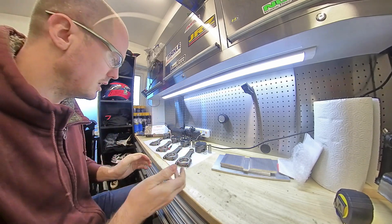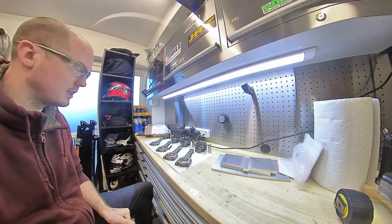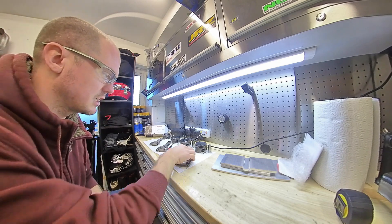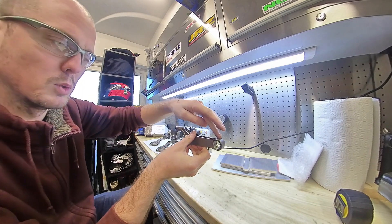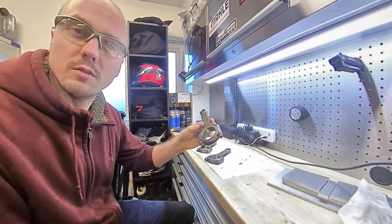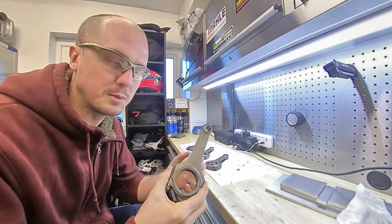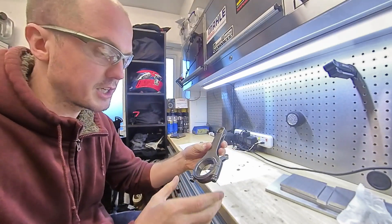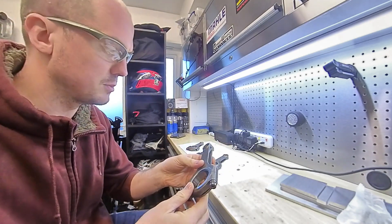The next step is to put away the old parts, put my Conrods somewhere safe, and then start building the Conrod balancing machine to make sure these are actually balanced - both the small ends and the big ends of the Conrod. As a lot of you know, the 2ZZG will rev to upwards of 9000 RPM, especially with the Supertech valve train that I've now run. So the importance is balance - if we don't want vibration, we need everything in the engine to be balanced as well as possible.